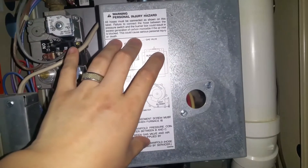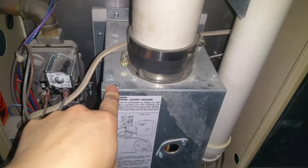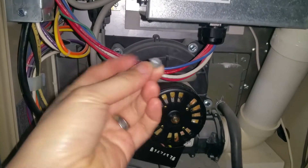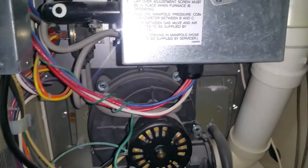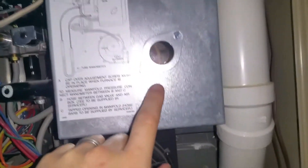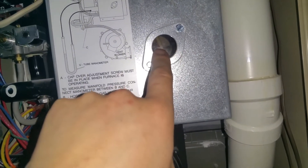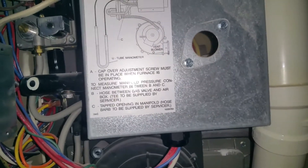Here is the flame box or the ignition box. To take this off there are four Phillips head screws — one, two — there's one more up under here, and here's the fourth one. The fourth one is actually connected to a ground strap, so keep that in mind. You can also take a peek and see an inspection window, and there's the power and the ground for the ignition, so you can check in there to see what's going on.